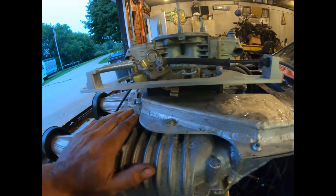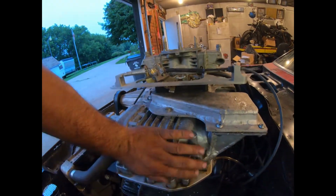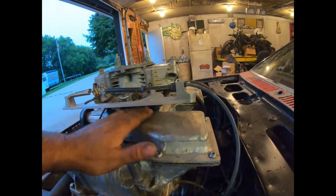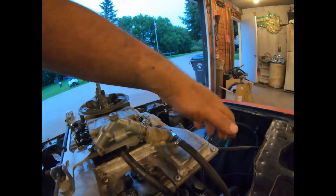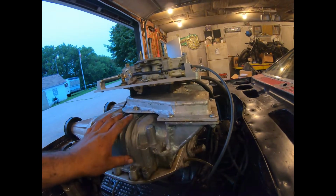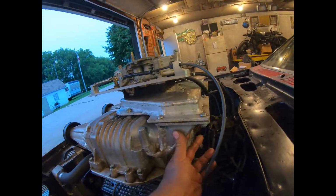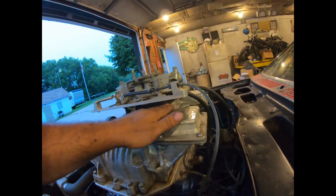Now, the superchargers, they're warm. They're about what they would averagely be on a Pontiac or anything with the 3800. But this right here, ice freaking cold, condensation everywhere. And both sides, obviously, where the fuel's dropping in. Down here at the bottom, this is substantially cooler at the back than the actual supercharger case. Obviously, the heat's going to be made here, but it hasn't transferred from here to here yet because it's just so cool up here. Kind of neat.